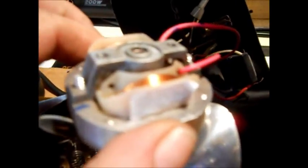That's how we're going to oil the motor. We're going to oil it from this side. Don't let that oil drip on these elements. I'll have a rag in there, a piece of cardboard. Then I'll oil the back. Just a couple drops in the back of the shaft, in the center. Then I'll spin it by hand and be satisfied I got enough oil on it.